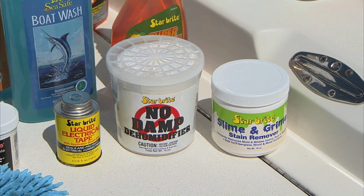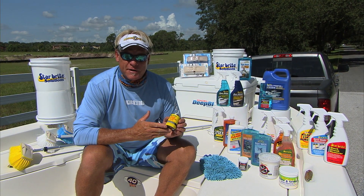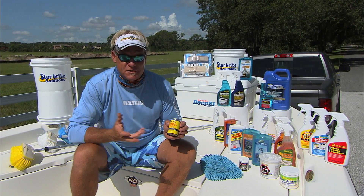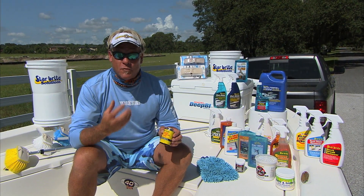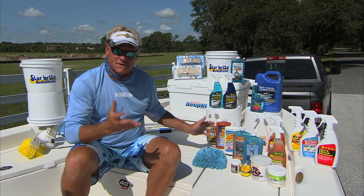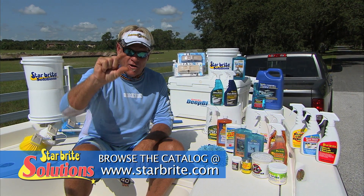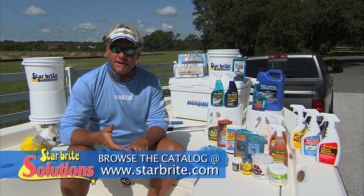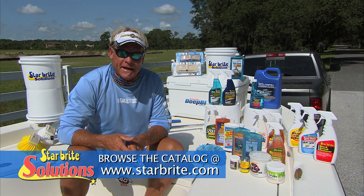A lot of people like to do their own wiring — this is liquid electrical tape. Once you get your terminal end on to your board or whatnot, put a little bit of this on there and it's just like electrical tape except it covers everything. Keeps it sealed so it doesn't corrode, and it'll work for as long as you need it to. They also have Boat Guard, Odor Guard, and Spider Away. This is just a touch of what Starbrite Products has to offer. If you ever get a catalog — they're about this thick — highly recommend it. They make everything from tie-down straps to bungee cords. It is in this catalog, and Starbrite makes it. One of the best products out there — I can basically say anything good about them.